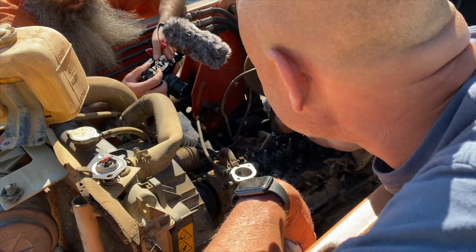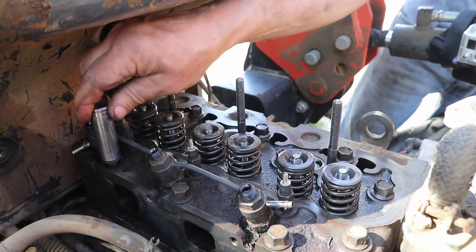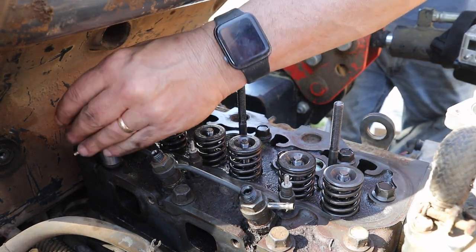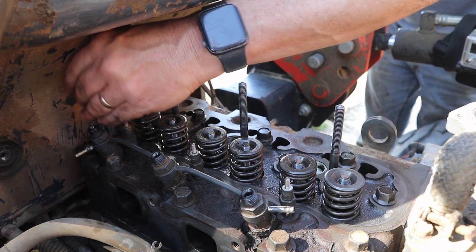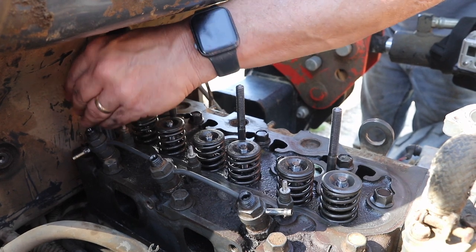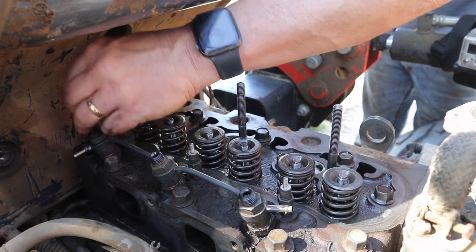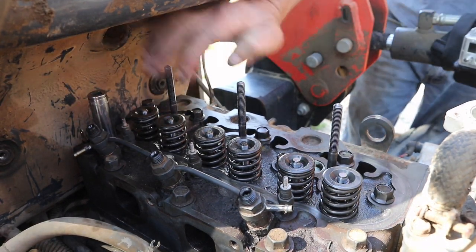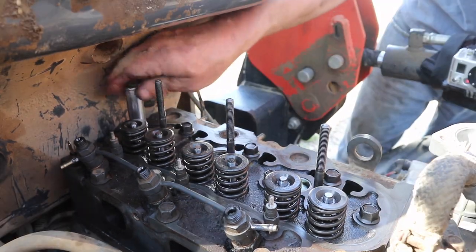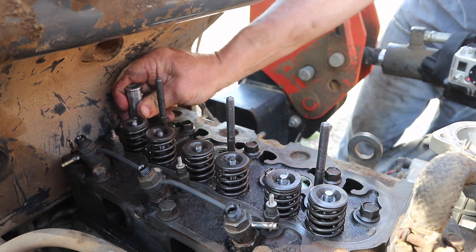You could look at that old gasket and tell. The only compromise was the ring at the top of the cylinder where it holds the water back - the water jacket. The head gasket has a lot of jobs: it separates combustion from water from oil. It doesn't look too complex but it pretty much is. The head bolts are 17mm, with a 14mm here as well.